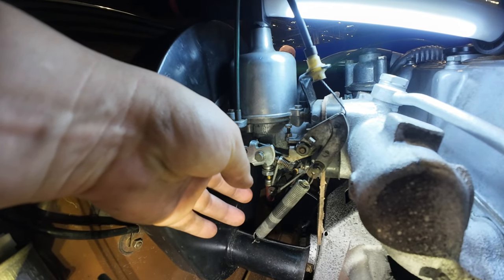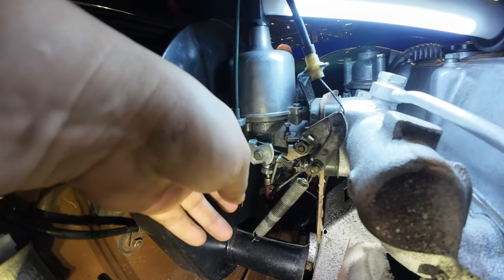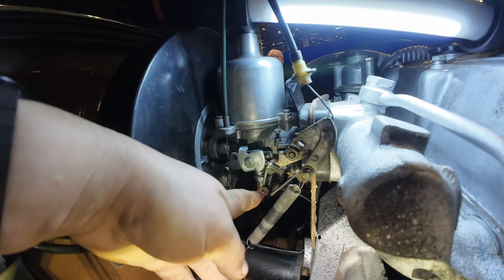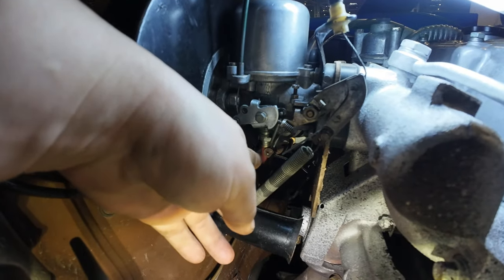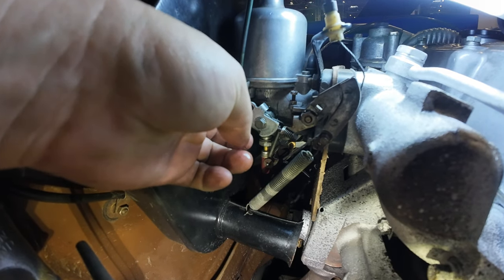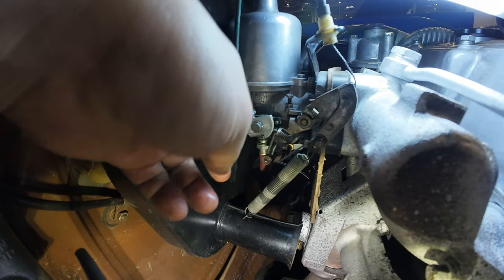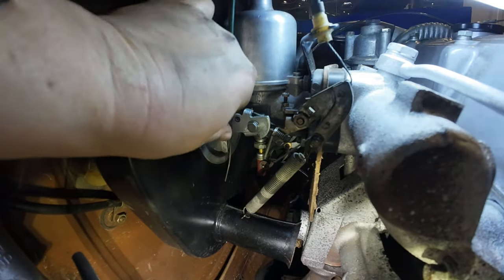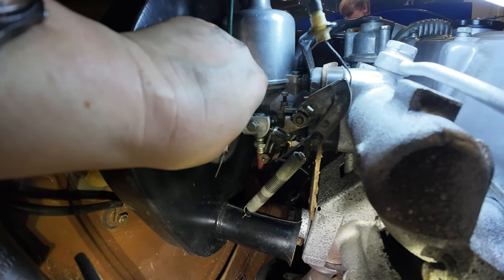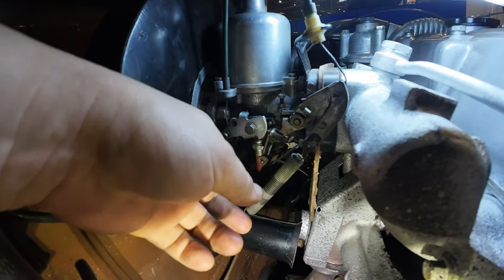And then when the choke goes in, it's meant to pop that up, but it's getting stuck. See that? I had to flick that up down there, that red bit. So let's simulate it again. Choke goes on. And then the choke's meant to go off. Ah, it went off then. But it doesn't every time. There you go, look. So now it's stuck. So if you give it a good old flick, but you can't really do that with an actual cable. It's not a stiff cable.